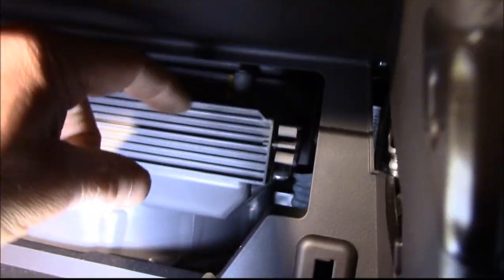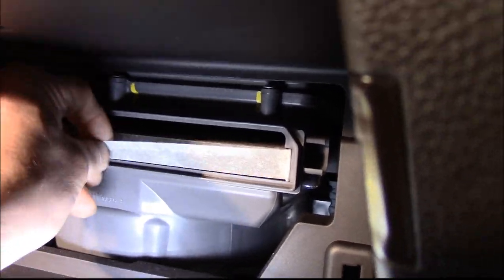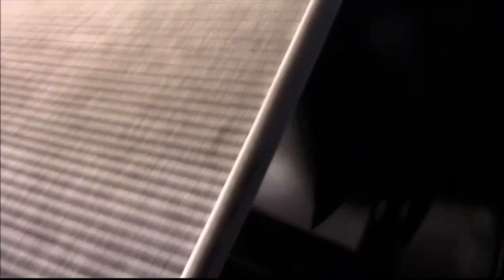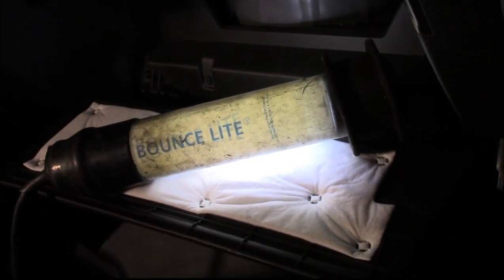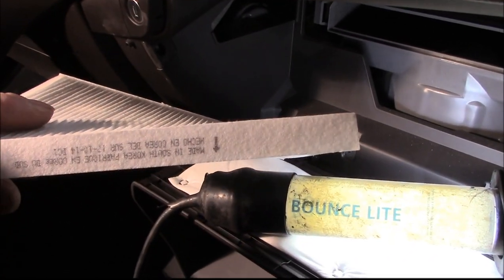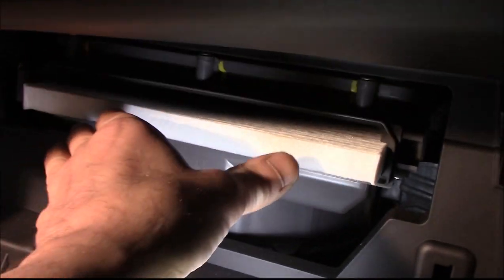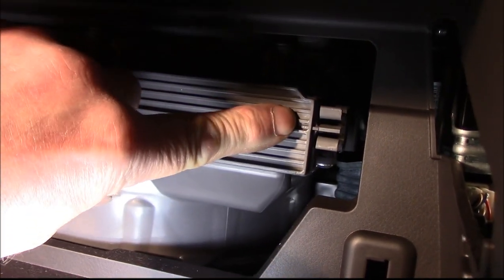This is where your filter is located up inside here. You just take these little clips on the side, pinch them together, take this cover off, and then pull the filter out. As you can see, there is a lot of debris inside there — it's just doing its job. Then we take our replacement filter. You want to make sure you have the arrows facing in the correct direction. The arrows face down, which is the way you want to put it in. You take it and slide it in, push it all the way in. Put your cover back on, hook it in and push it — it snaps in place.